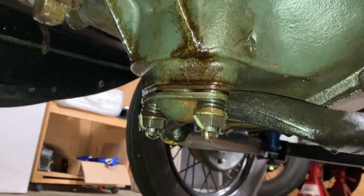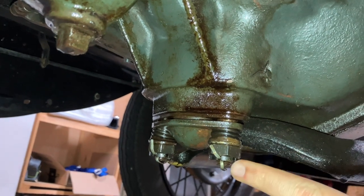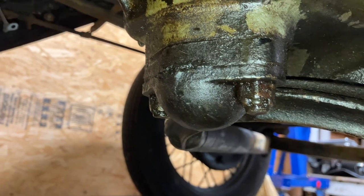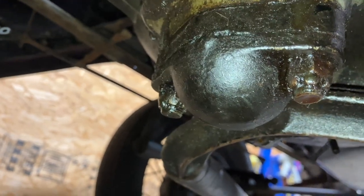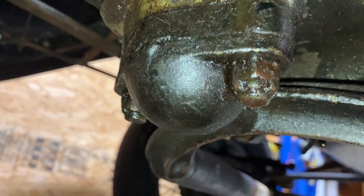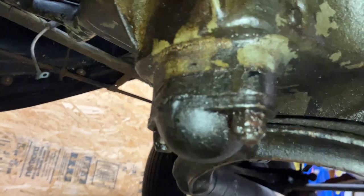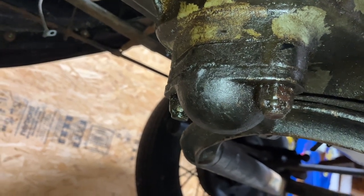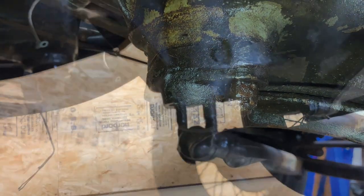These diagonal lines are the radius rod. The front radius rod is a single piece and we have to take it off. Your radius rod ball socket might have several layers with springs, washer, nut, and cotter pin — or it might be a more unitary construction with no springs and no cotter pins, just nuts. Either way it's basically the same to take it off — take the cap off and get it down to the point where the ball is just hanging loose under the transmission.